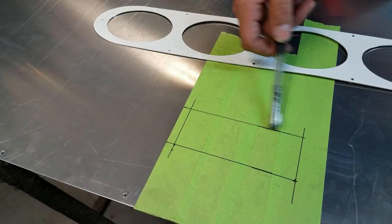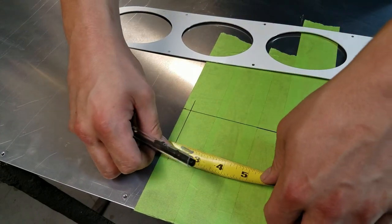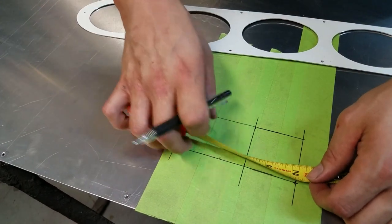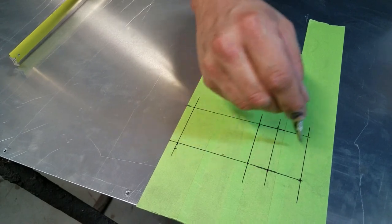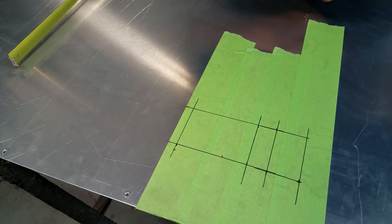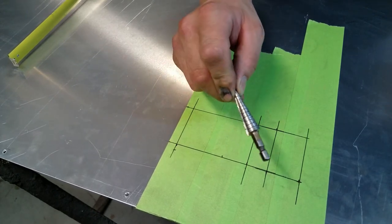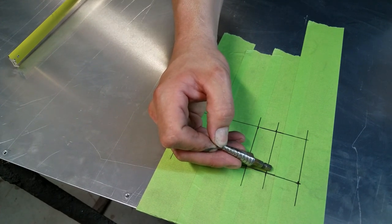There's the opening we need — basically for our lock and for our latch. The latch itself is actually three inches, and the door lock is an inch and one quarter. To start cutting these out, I need to drill a hole at all four corners of each piece that we need to cut. The hole I'm drilling for our saw blade to fit inside is a half-inch unibit, so I need to mark a line in one quarter of an inch.